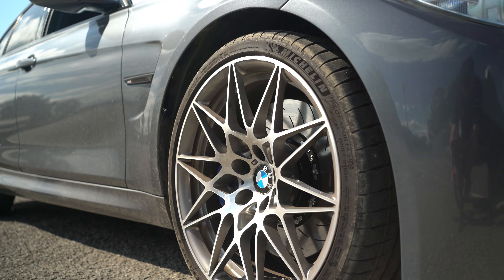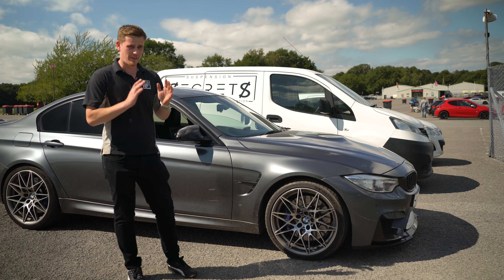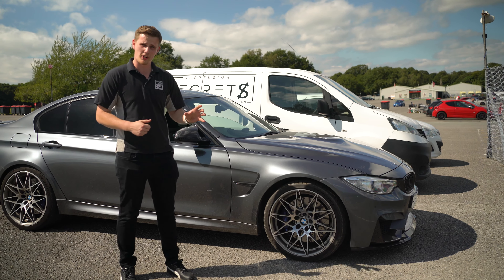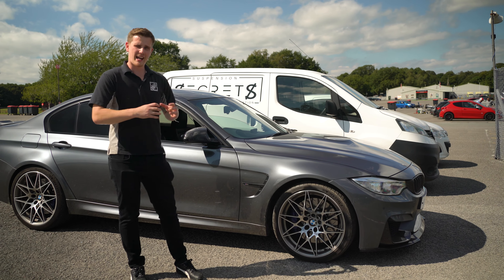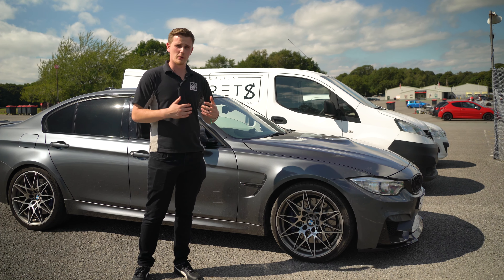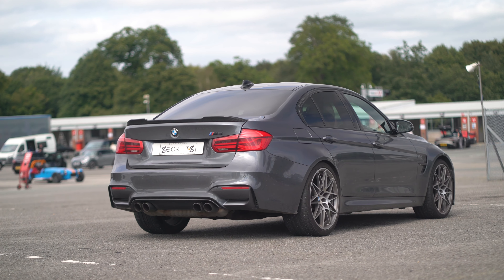You're looking for an operating pressure usually between 30 to 34 psi — it does depend on the tyre and car — but it's a really nice way of getting grip back into the car without ruining your tyres. Another very important check is your wheel torques. If possible, buy a torque wrench and a socket and check those wheel torques before you head out on circuit, and keep checking them throughout the day to stay safe.